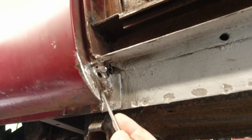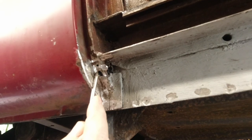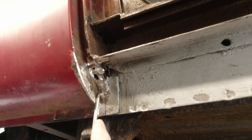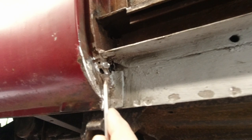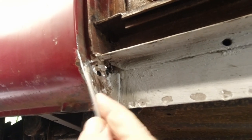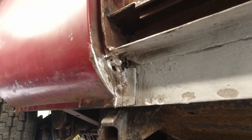We can, but we'll be taking most of it out again, and it's a lot of work. So if I stay out on the edge here, about 3 mil out from the corner, we'll be able to put our weld there, and we'll also be able to clean it, which is the most important thing. Access to clean your weld. You mustn't ever forget that, because if you put a weld into a corner, especially in a tight area like this, it's very hard to clean it up after.